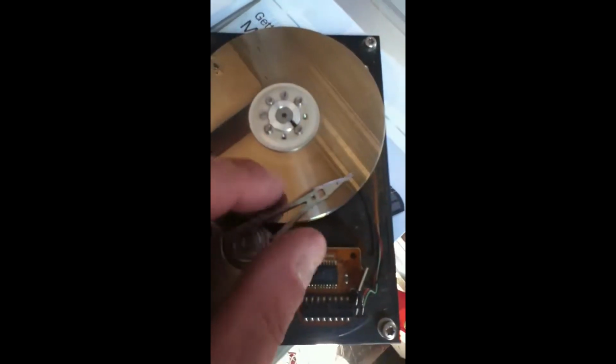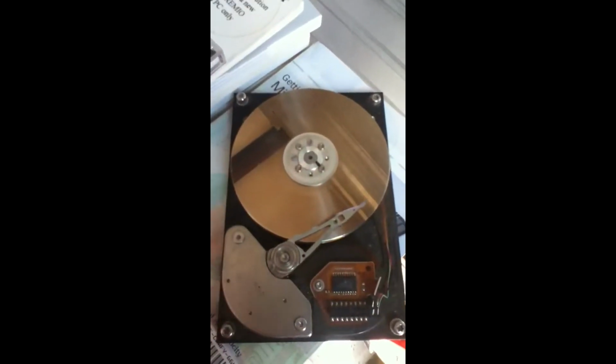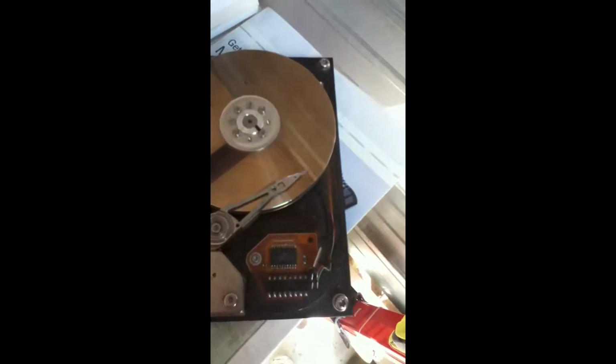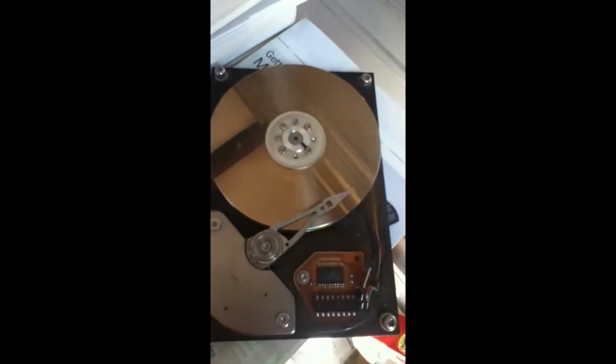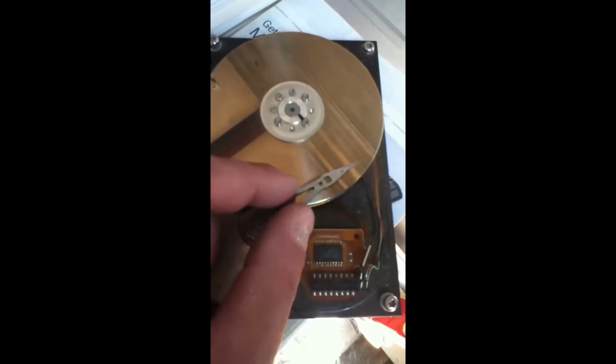The hard drive, when low-level formatted, is like a road without lines, no sector delineations, nothing. No stop signs, no lines in the middle of the road to indicate where the lane ends, or the passing lane. And these are the feelers. If we take a look at the side, there's four sides to this hard drive. 2 discs, 4 sides, 4 feelers.